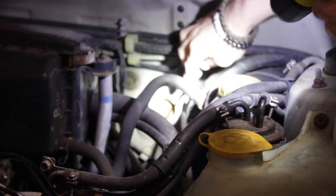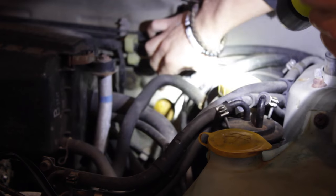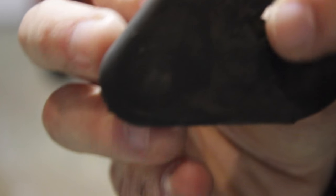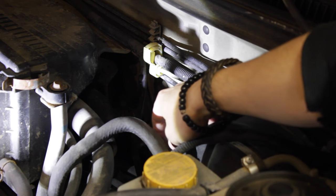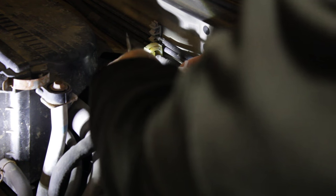You can easily fit a screwdriver through here — your vehicle may be different, but there's a rubber grommet that goes here. What I did is I just cut a little hole in the middle and slit it so I can easily fit the wire through. I put the toggle switch through the firewall and now I'm taking the rubber grommet and attaching it back into place. Took a little bit to get it in there but it finally went.